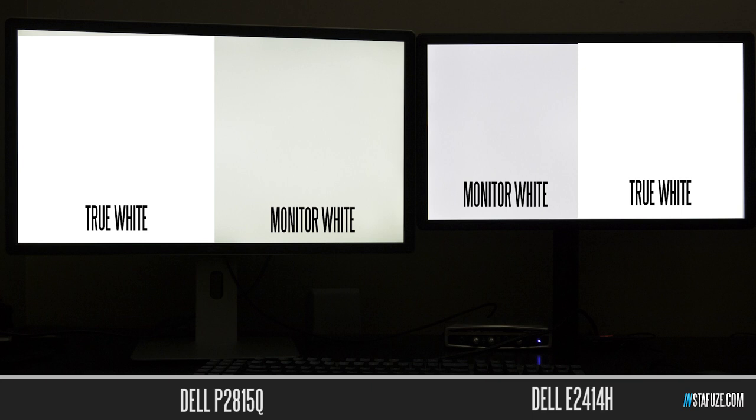This isn't the end of the world because you can calibrate the 28-inch to match a more representative color, but you're never going to get truly accurate colors because it's limited to only 8 bits and doesn't have a reference-grade panel inside. It's definitely no UltraSharp, but you can color calibrate it to be more representative. Just out of the box, it's not as good as even other consumer-grade Dell monitors.